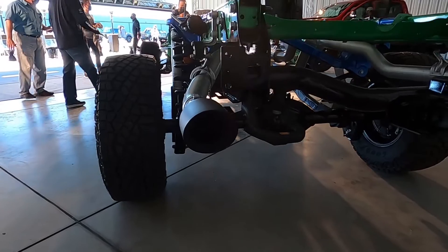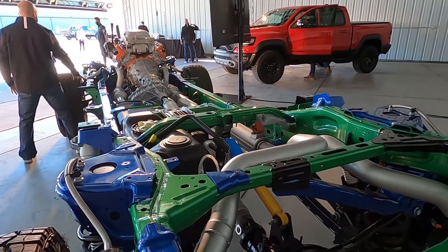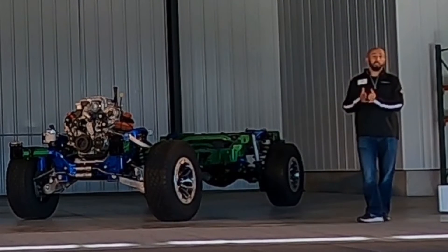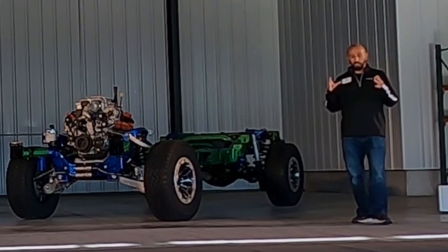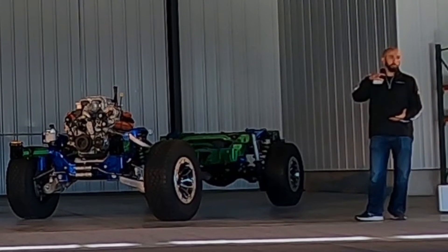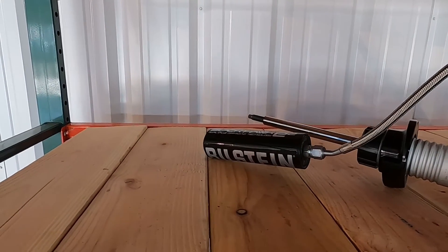At the rear of the vehicle, you'll find lengthened steel control arms, a solid 4-inch rear track bar, again for that punishing duty cycle. One of our engineering trophies — and it's kind of funny to hear engineers get all excited about a spring — but that rear spring managing through this massive 14-inch rear travel is a huge, what we call a beehive, essentially the tire envelope. It's packaged hard against the carryover box inner. This is a pickup truck; cargo is a significant contributor. So we had to package this very large travel and diameter coil within that. What you'll see on this TRX is the largest, tallest production coil spring in the world. We had to scour the earth to find a supplier who could actually make something like this — for all of us, it's a source of pride.